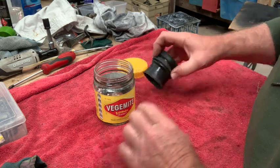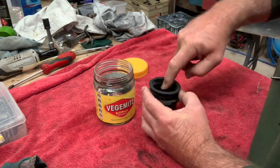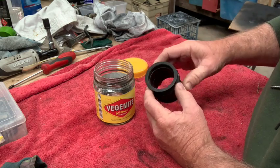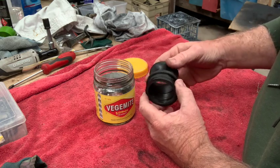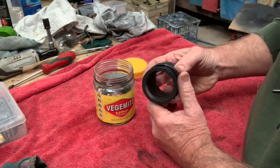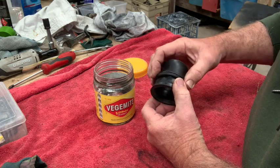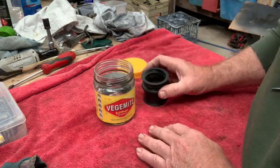There's also a little metal spring section inside the rubbers that holds them out - those have been taken out so they'll have to go back in before the carburettors go on. I'm also thinking I might be able to push them through from inside the airbox after the carburettors are in position, but that lip there looks a bit high to go in from the back - I think they're going to have to go in from the front. We'll see how we go once we get to that point.